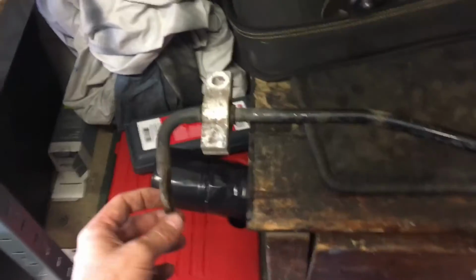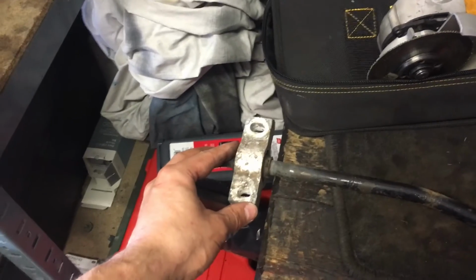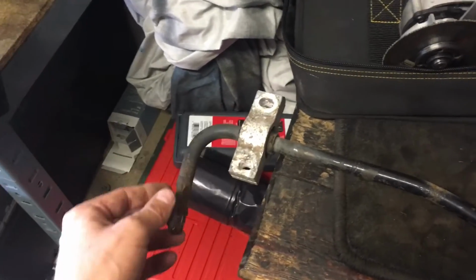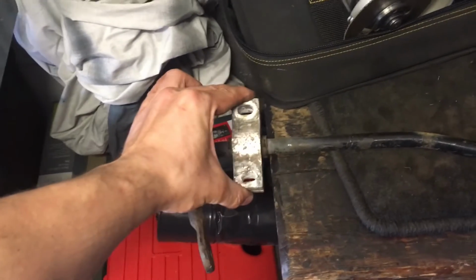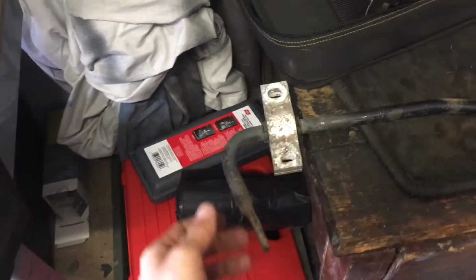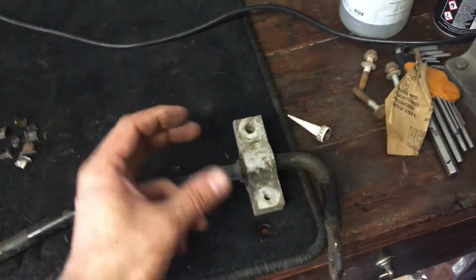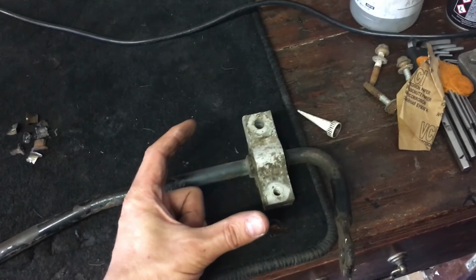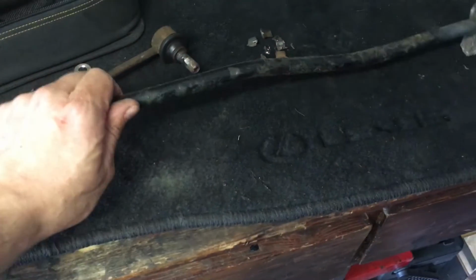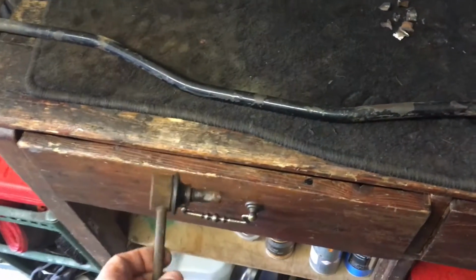It proved difficult. And one of the main pains as well is something I didn't realise, is that the rear anti-roll bar bushes are moulded onto the anti-roll bar itself, and these brackets are not designed to come off. So even though they come in two halves, you can't split them because they're glued in place. Which makes clear why I was provided the U-clamps and fresh bolts with the rear bar and not the front, because obviously these you can't swap over. But it made getting this out an absolute epic. However, managed it. It didn't make for good filming.